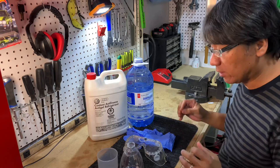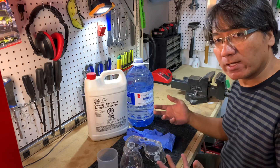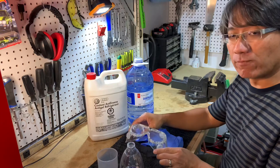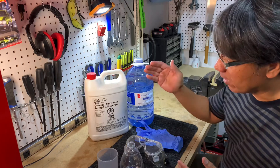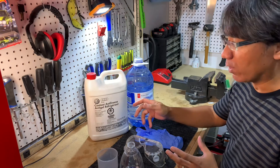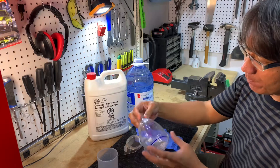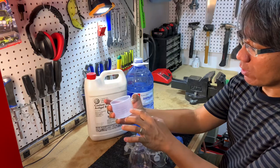Here's all the stuff that we need. This is a very simple process — I'm almost making it look more complicated than it is. You do need gloves and goggles, especially when you're mixing coolant with distilled water and antifreeze, because this is poisonous and you don't want it on your eyes or skin. I have a mixing beaker and a measuring cup, and I do a 60/40 split.